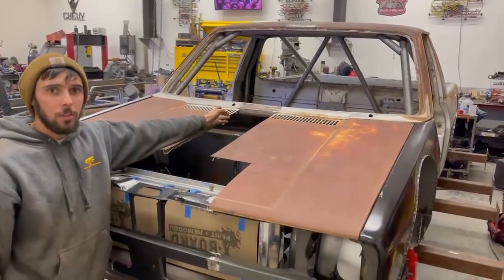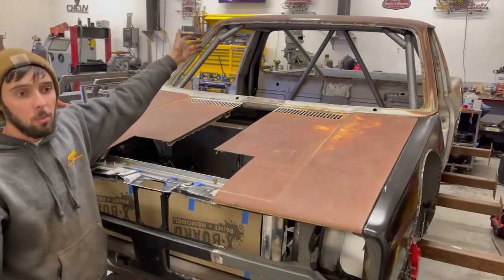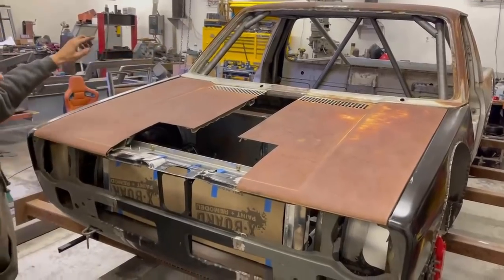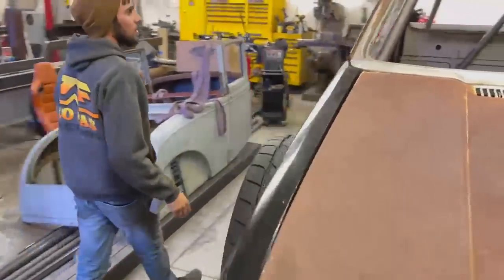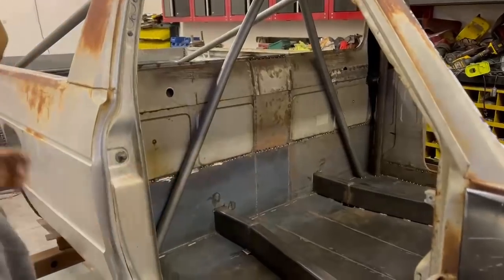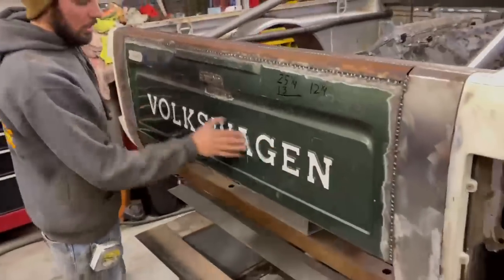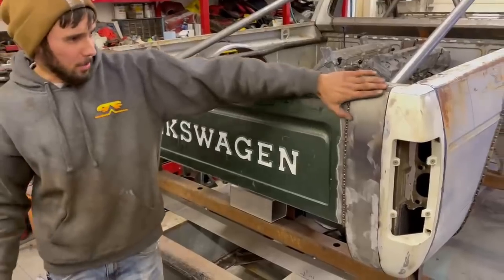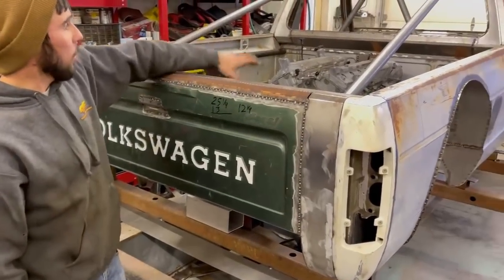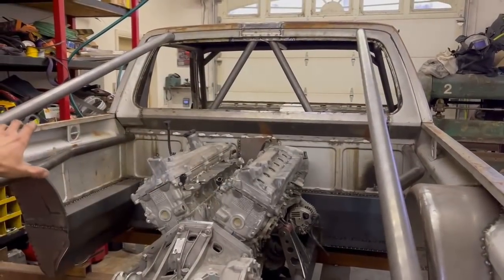Then I continued up to the center of the car. As you can see, I widened the cowl here — an 8-inch strip that's all been flanged and welded in. Same with the firewall and the roof; the roof is actually panel bonded rather than welded, just because I didn't want any distortion or warping. You can see down through the center where the whole back has been re-widened. On the tailgate I made strips that are only four inches wide on either side to continue widening it while keeping the original Volkswagen font. As far as rust repair went, I replaced panels across the whole back below the window that were rotted out, and now it's one single piece with no more seams.